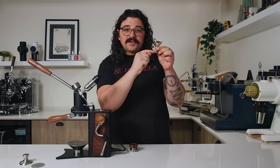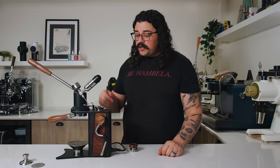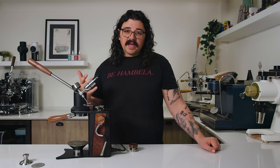But as you can imagine, with it being black and it's difficult to get light in there and the hole is so narrow, it's difficult to see when you're there. So you need to get like a flashlight or something over it to really ensure you don't overfill. If you overfill, you could actually hit over 3 bar of pressure inside and it might need to rely on the anti-vac or the safety system. But on top of all that, you can also get some leakage or some condensation that's going on inside of the machine itself. So it's very important to not overfill your machine because it can lead to some problematic issues. Nothing that's too devastating unless you do it all the time, but something that is a quirk nonetheless.